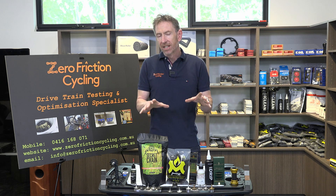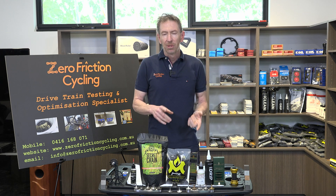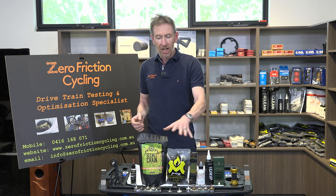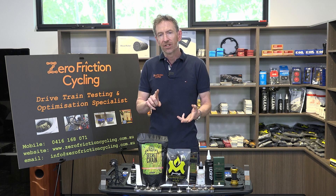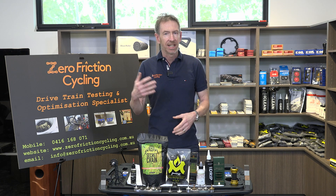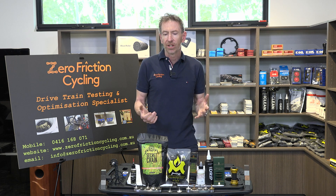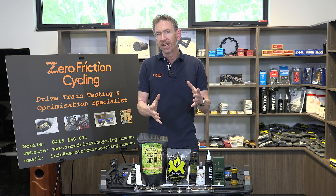There's quite a big difference in the maintenance required for wet lubricants versus chain coating or wax lubricants. With wet lubes you need solvents and must dispose of them carefully. With a chain coating lubricant or immersive wax: dry road riding needs basically no cleaning ever; heavy dust means just wiping with methylated spirits on a cloth; and after a full wet ride, you boil the kettle, swish the chain in boiling water to melt off the coating, dry the chain, then re-lube or put it back in the wax pot.